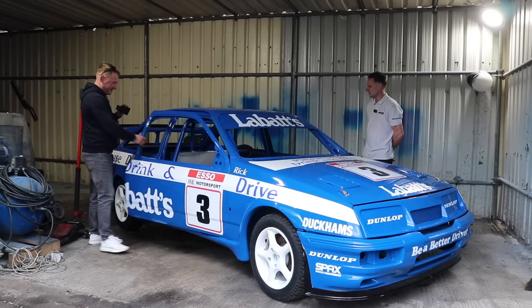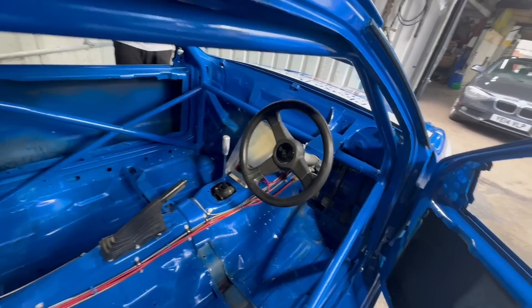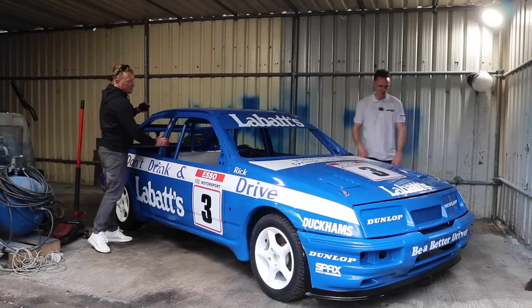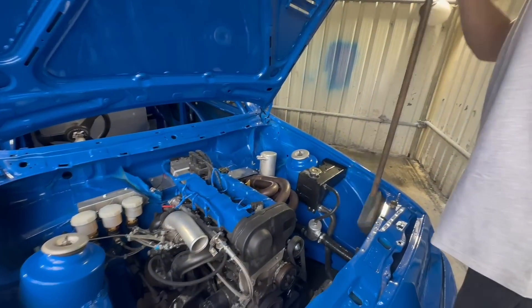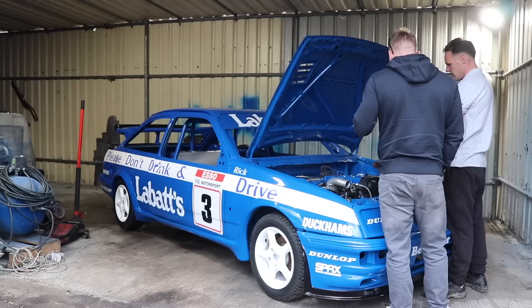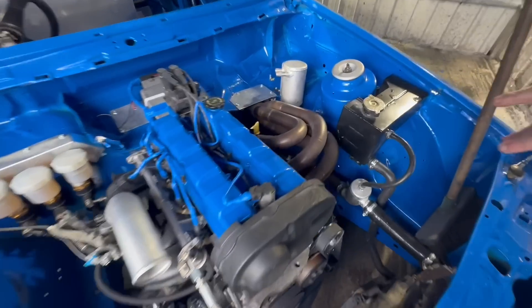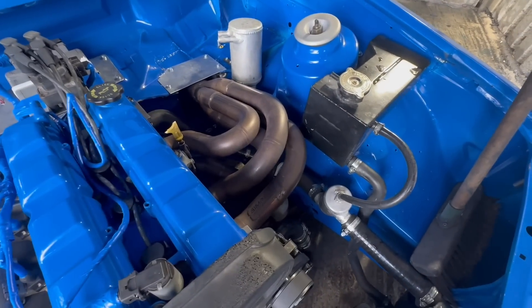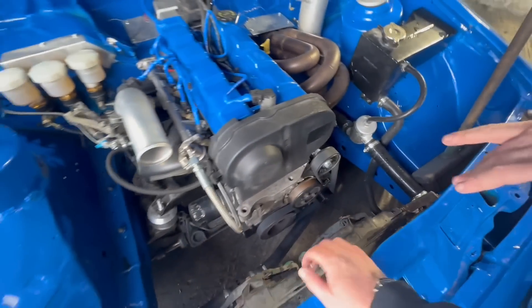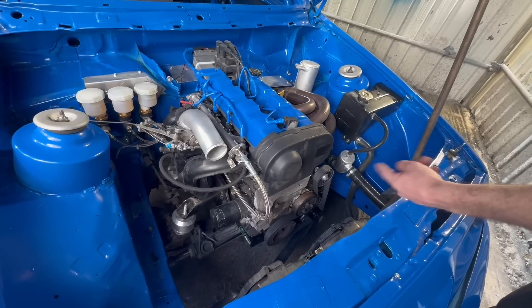There's no seating yet but it does run. Let's pop the bonnet and show people. This is a Focus ST170 engine - engines have to be standard. The exhaust manifolds are free so we've got a Simpsons race exhaust on there. Engine mounts we're allowed to make ourselves, and it's got a DA Performance oil and water kit because the belt runs the wrong way for the water pump.